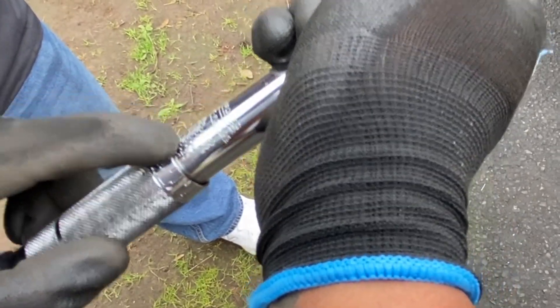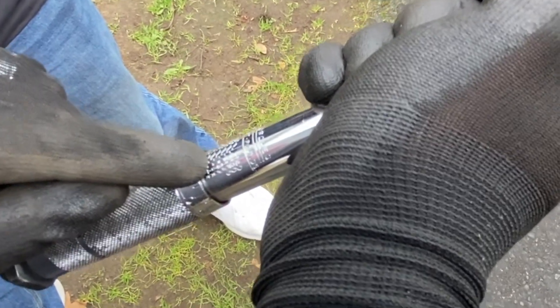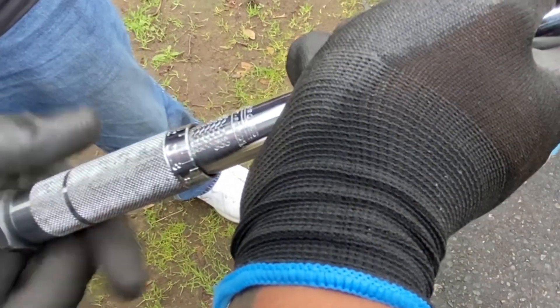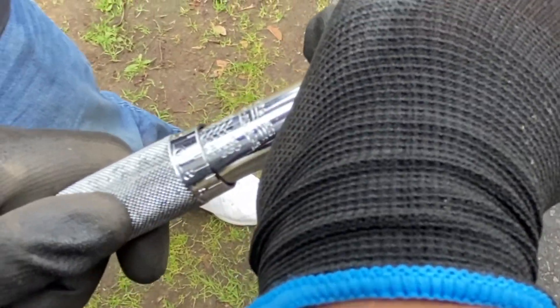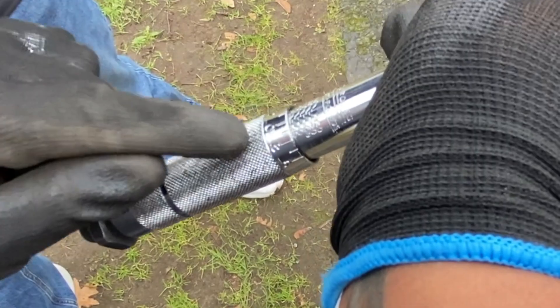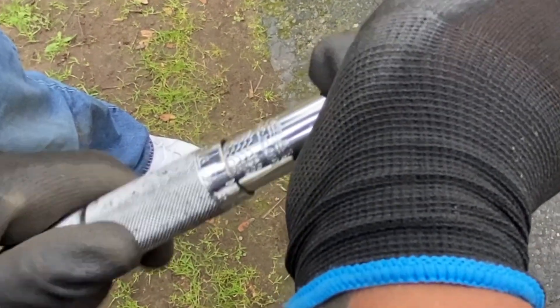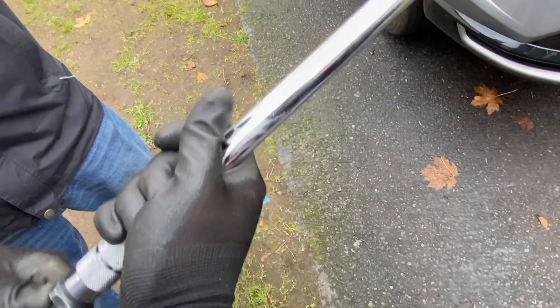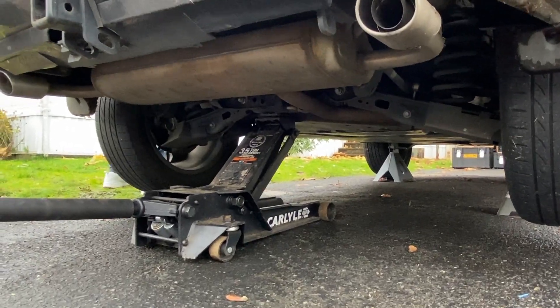So that's 70 right here — see how the line goes down. The bottom part of that line is 70. What you want to do is turn this up to where it gets to 70. This is on zero, so that makes it 70. You want 76, so you just keep turning this until you get to six on the center line, then tighten it down. Now you're at 76.